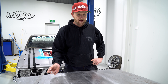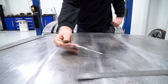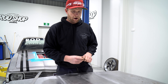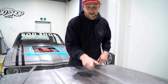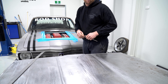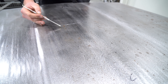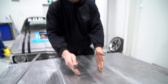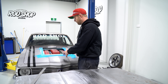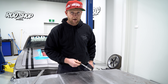I've gone ahead and worked out a centre line for the bonnet — this big scribe line running straight through with that C on there is the centre line of this hood. What I've done is worked out a really tight cut, which is going to be very, very snug on here hopefully, where this dotted line goes around. For now I'm just going to do square corners, because I know this is eventually going to get larger. I'll get that out, get this hood back off, and slip it straight back on. That dotted line will be the first cut we make.